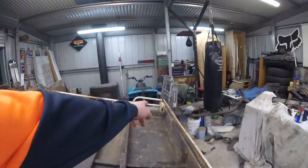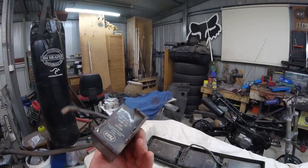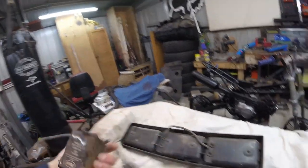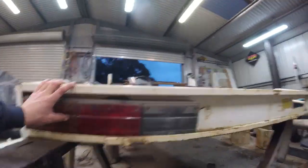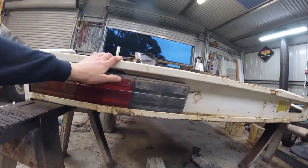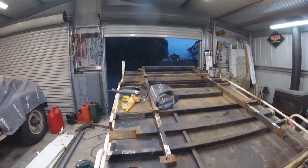I've also just removed the little reverse beeper and the two number plate lights because it was all just corroded and ruined. I just cut the bolt heads off with a grinder, so it's pretty destroyed, but it's all rusty and crap anyway — if I do get a new one, I'll be replacing it. These are the tail lights I'm going to use. They just slot straight into there and fit pretty good — I've just got to centre them. For now I'm going to keep grinding everything and try to get that beam removed and keep cleaning up all the old welds.